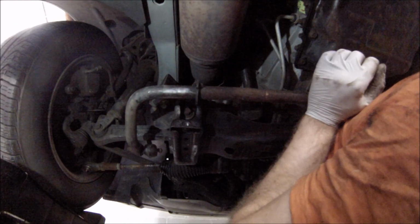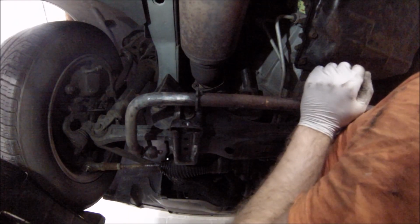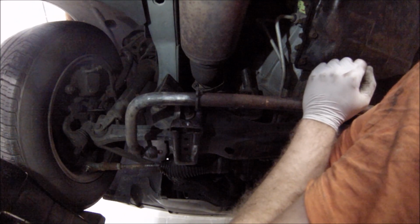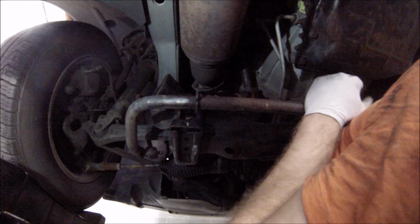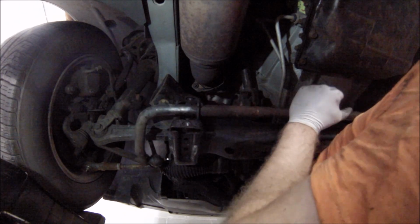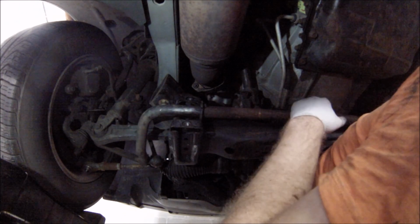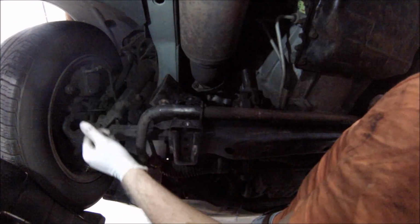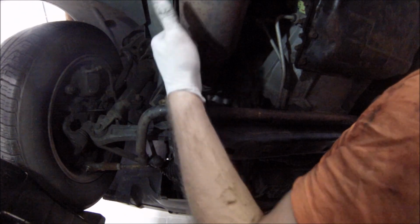I would like for you to find the section about the stabilizer bar, please. Okay, yes, the bushings are removed on installation. Now there's a bit that mentions how the bushings face a certain way. It says, please note that these face this way and they must be reinserted. Note that the slit in the bushing is facing towards the rear of the vehicle and must be installed in the same direction. Okay, so the slit must be facing the rear of the vehicle, so it must be facing this way.